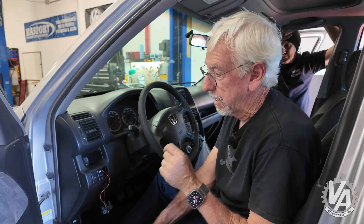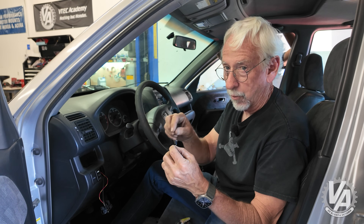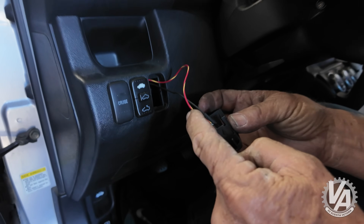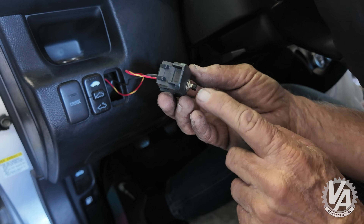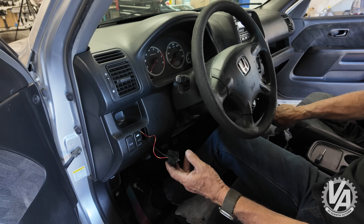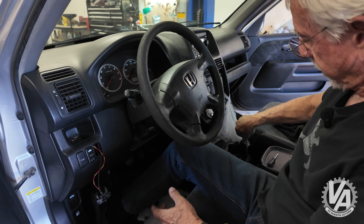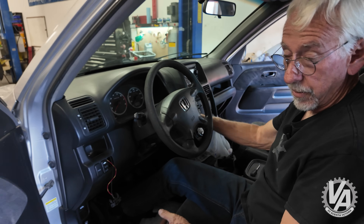When I modified the CRV engine harness I added a reverse lockout. I took the intake manifold runner control solenoid valve and shortened that wiring to be our reverse lockout. That wire comes back to B22 on the ECU, but there's nothing there on the EP3 ECU. So I disconnected that wire and brought it over to a switch — the wire comes in on one side and out the other side to ground. This is a momentary off switch, so there's continuity unless I push the button. Right now with no power, you can easily shift the car over into reverse.